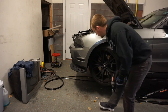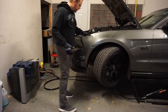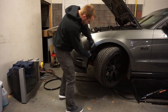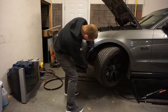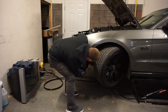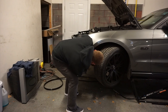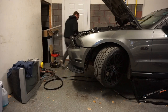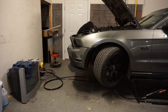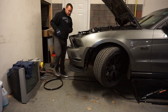I'm going to go ahead and get the bolts on the other side and then come back once this is ready to pop off. With all those bolts off, you can go ahead and start to pull the bumper out. All you do is pull at the top, give it a nice tug, and it'll pop free. Then keep pulling and we've got to get past the bracket stuff underneath. Now your bumper is more or less free to come off.